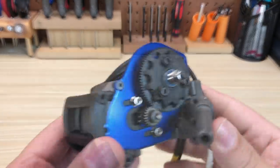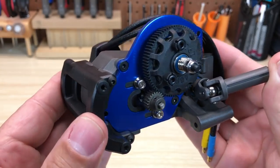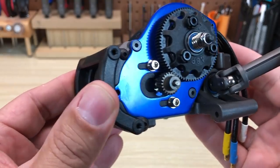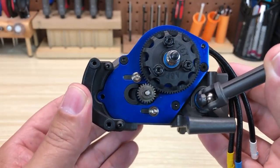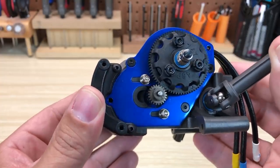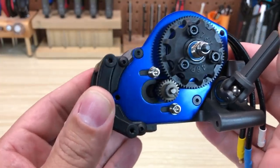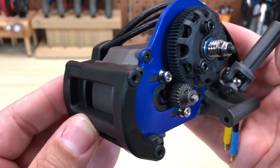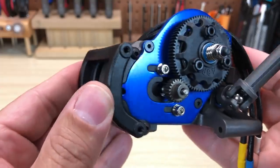With the gear cover off, you've got a torque-controlled slipper clutch — the three-pad design we've seen before. You can also see how there is an insert that goes into the motor plate that sets the gear mesh and makes it immobile. So if there's a crash or an impact, you're not going to have that motor shift. It just makes it easier to set gear mesh — with that insert, you just put the motor mounting screws in, tighten everything down, and your gear mesh is set properly.